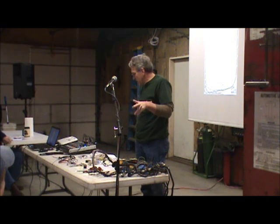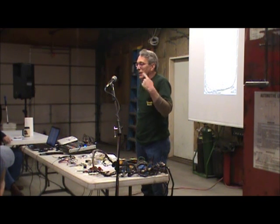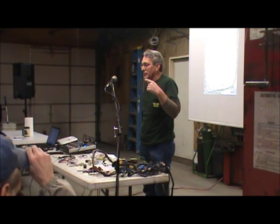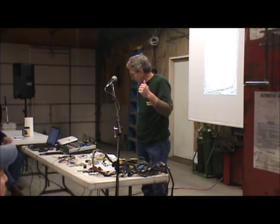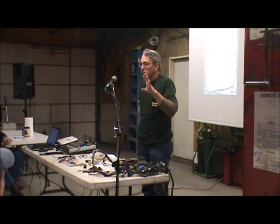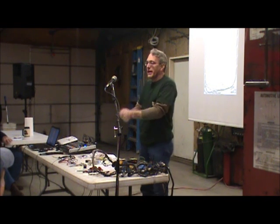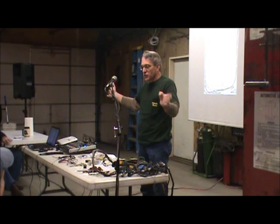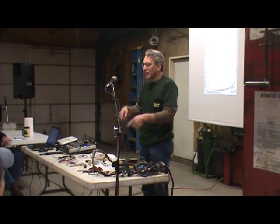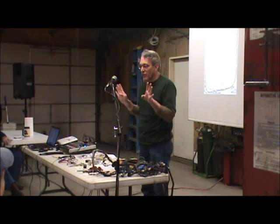One of the biggest things when you're troubleshooting, and I do a lot of service work over the phone, people are trying to work on the stuff that I build, and I'm dealing with lots of different skill levels, is I try to force the guy on the other end of the phone to be methodical. Don't jump around. Start at one spot, work your way down the line, because it's just one long straight path from here to there. Supply, delivery method, load, ground. The problem is in one of those four.